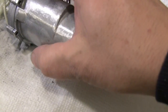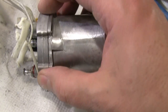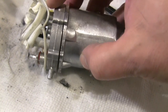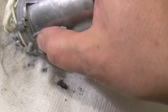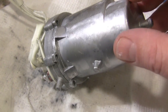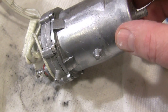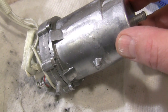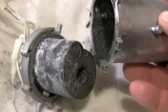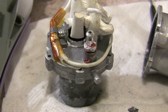Okay, I'm showing you this after I took it apart and it got cleaned. I was first worried that there was a gasket or some sort of spraying mechanism or something else hidden inside these units. I should have known better. Mine was stuck solid by the calcium. So I got all the screws out, and I couldn't pop it up. I gently used a very fine screwdriver and pried my way around until I got enough of a gap, and then I was able to pull it apart, and it just slid right off like that, and it poured out a pile of calcium dust.